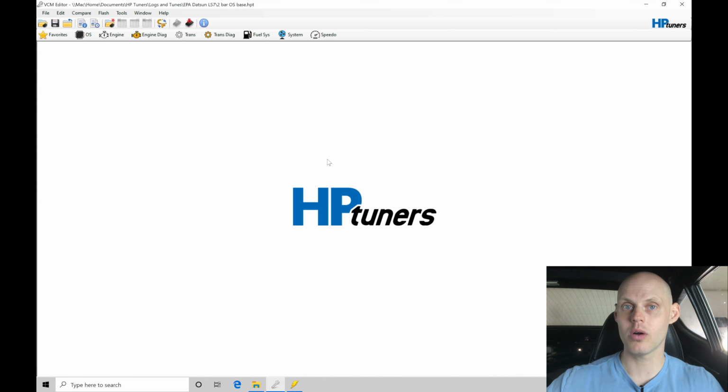So some of what we talked about and looked at within the Gen 4 training course is going to be applicable here, but I'm going to be trying to introduce some new ways to work with the idle control because we have some new parameters and PID channels available in our VCM scanner, which can shed some light on what's going on with the closed loop control. Before, we were left a little bit in the dark.